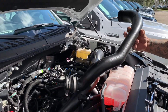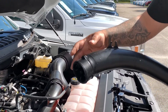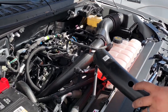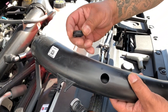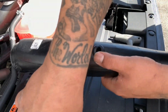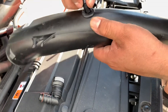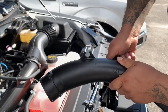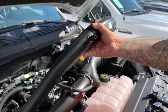To drill the pipe, you'll need to remove the clamps — one down here by the turbo and the other going into the air box — and the pipe will come right out. Drill it with a step bit to 22 millimeters and use the provided grommet from the kit. Pop the grommet in, then twist the fitting in.